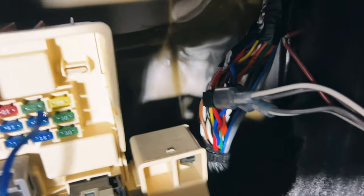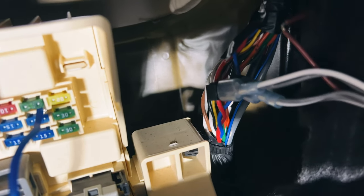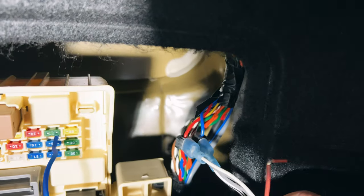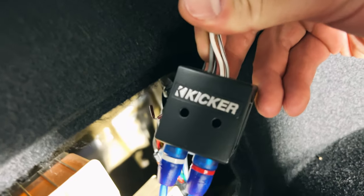This is the base GT, so there's a little panel here on the side — you're going to remove that. Look very carefully at these wires: there's a red and a blue wire in that harness, and he tapped into those. Zooming in, you can see to the far right there's another blue wire with a black stripe going through it — that's obviously not the one we're tapping into. Out of all the wires here, it's a solid blue wire and a solid red wire. Red is power, blue is ground — take a good look at that.